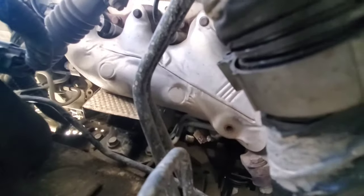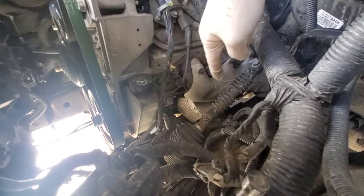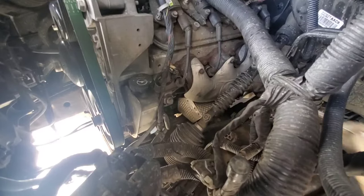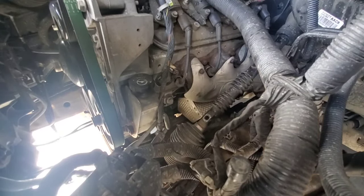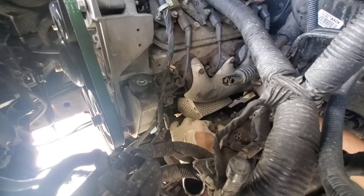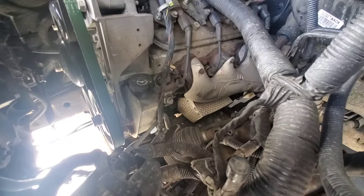And then the engine mount. We've got to get the steering out of the way. Scoot in here — you've got one bolt-nut there, another bolt-nut up there. That's what it looks like from up above. After you get those out, that middle section — I call it the intermediate shaft — it'll just pop out. It connects the steering wheel portion of the column to the rack and pinion portion of the steering system. You've got to be careful because when you remove this, your steering wheel can just free-turn. That can really jack up your alignment and ruin the clock spring in there. So just make sure your steering wheel's not going to go spinning around, no kids are going to play in there. Pull that guy out — we've got some room to work now.